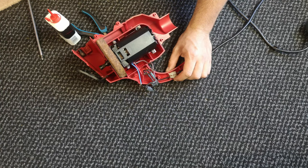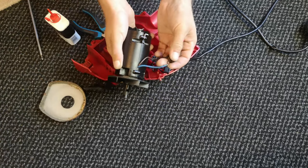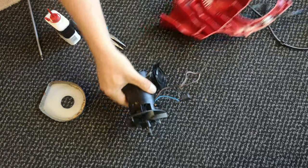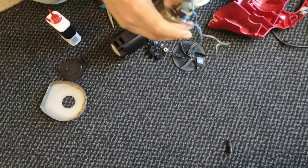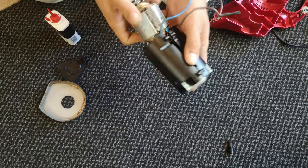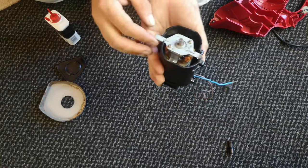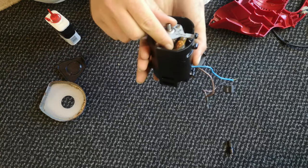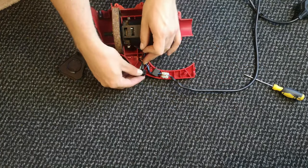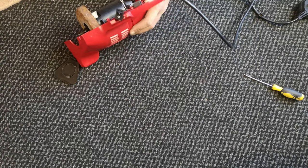Oh no - we have some problems. I put this together wrong, and because of that the neutral cable isn't long enough - it's obviously going the wrong way around in there. So I have to redo it. As I'm holding it, the live will go under once and the neutral will come straight out. There's a little notch so I just have to open this slightly, feed the cable back through, and line those cables up. I've now got that bracket 90 degrees - but once everything lines up and connects, the switch will have to be fiddled in when we put the casing on.